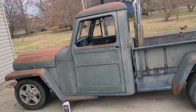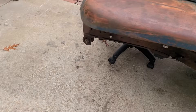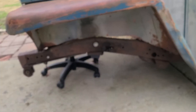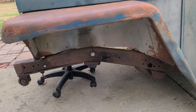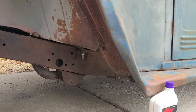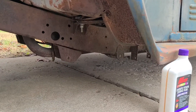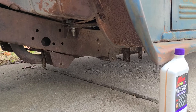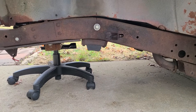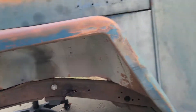A couple of dimensions here: the axle centerline is in the middle of that snubber and that is about 13 inches. There's quite a bit of frame kick-up on this. I'll get rid of the old spring perch and the old transmission mount — all that's going to be gone. I have about 8 inches of frame clearance at the bottom and 13.5 inches up to the snubber, so if we run a 26-inch tall tire the actual centerline will be right in the middle of the bottom of the frame where it's supposed to be.